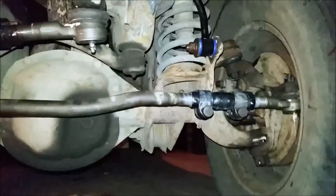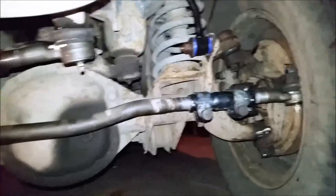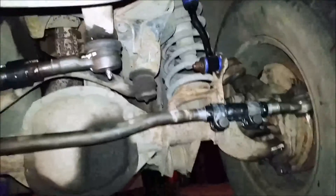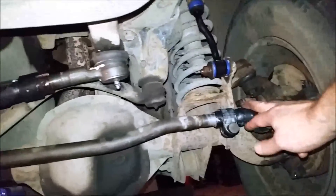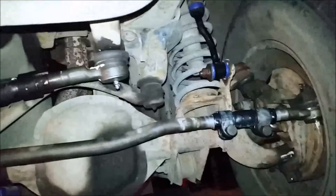As you can see, we've got our new tie rod on here - Grand Cherokee tie rod along with a few other goodies - and it fits perfect. No screwing around or modifications necessary. A '95 Grand Cherokee V8 tie rod fits right on. Beefier. All I've got to do is adjust my alignment now, which I'll do by twisting this adjustment sleeve instead of the whole tube like the old one. That'll work just fine. Good luck.